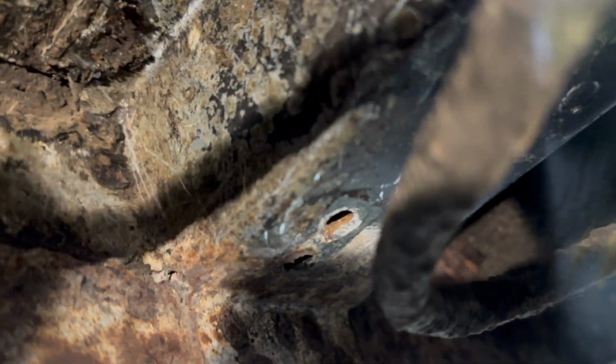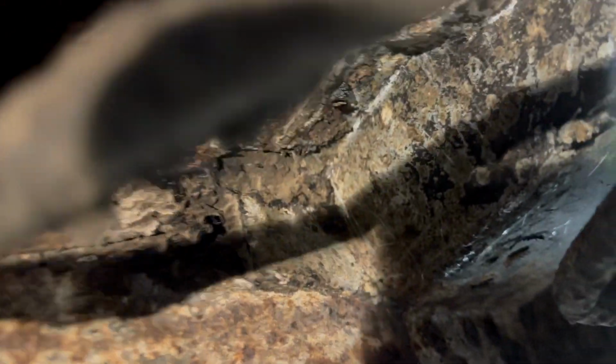Okay, here's a little update. So I've cleaned up. First thing I did was pull the brackets out of the brake line. There was a fuel vent line here, and I just pulled that out because it went to the charcoal canister that's no longer in the car. So we pulled that, and then I cleaned up a little bit on the edges around the floor braces.